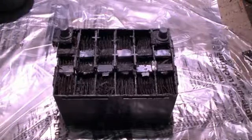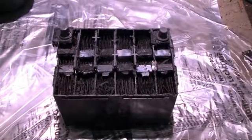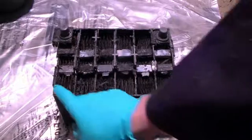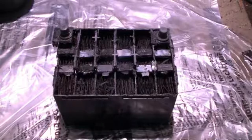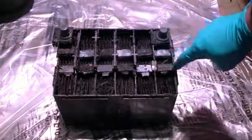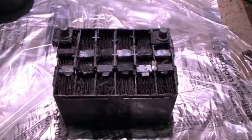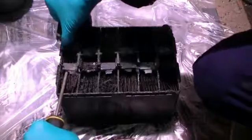In this used lead acid battery, the electrolyte has been drained and the top has been hacksawed off, and what is clearly visible are 6 independent compartments. The cells are connected together by bars of lead which then connect to the terminals of the battery. This particular car battery is actually 6 years old, has lasted very well, especially considering the abuse it has been given, so it'll be very interesting to see how it's failed.